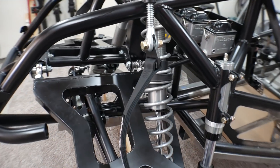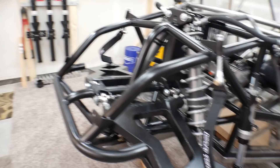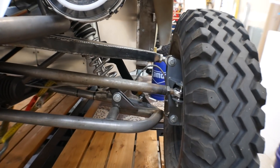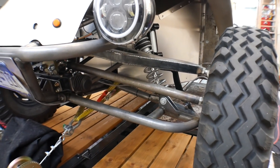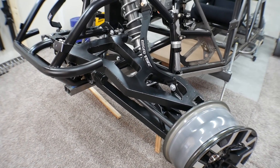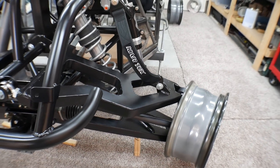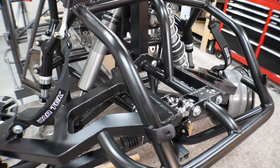What we're looking at here is an A-arm front suspension system. This is on the ratchet chassis. This is very similar to what I had designed on the front of the Mauler chassis. That system worked out pretty well, but I wanted a system that was a little bit bigger, capable of larger tires, and basically just designed for a little bit more abuse. So the system I designed for this chassis, the ratchet chassis, follows the same basic principles as that design. However, this design is larger and it follows a little bit better geometry rules.